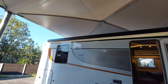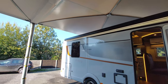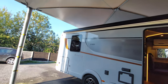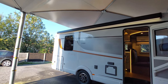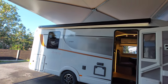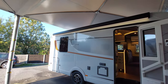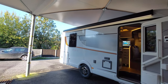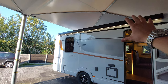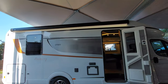Above there, you'll notice that you've got your Thule awning. I'm going to send you a separate video showing how the awning works, as I've only one hand to film this video. But there are two things to remember. The main thing is if it is a windy day, please take the awning in — you should never really use the awning in wind, because it will pull it from the vehicle, potentially damaging your van and other vehicles on site; it's like having a massive sail on the side. If it's rainy, although the awning can be used in rain, I'd recommend taking it in — you should never keep the awning soaking wet, because after time it will become mouldy and deteriorate.